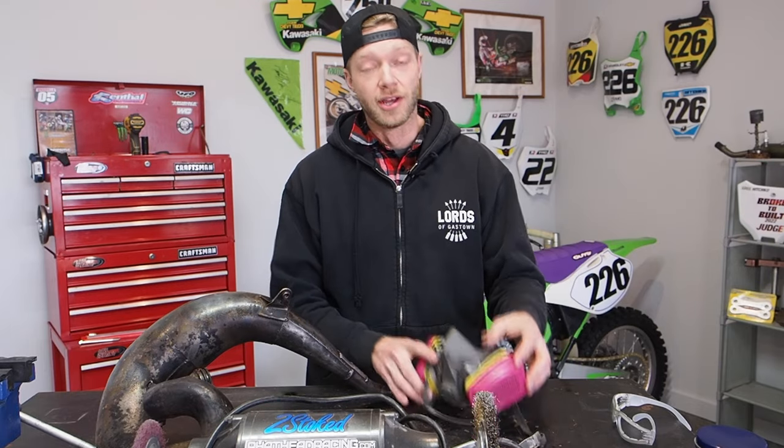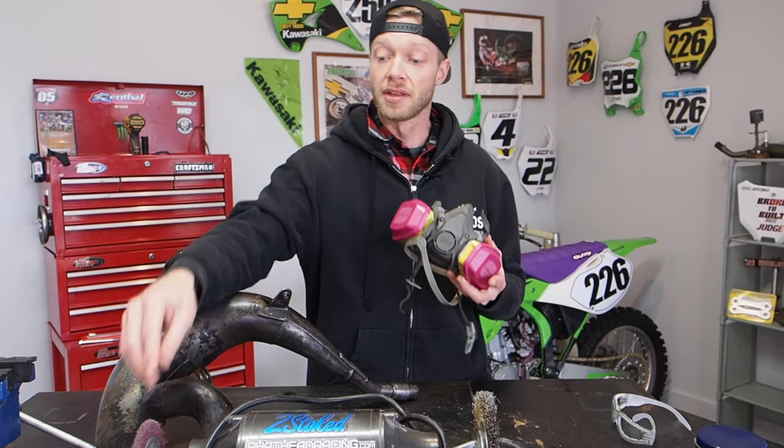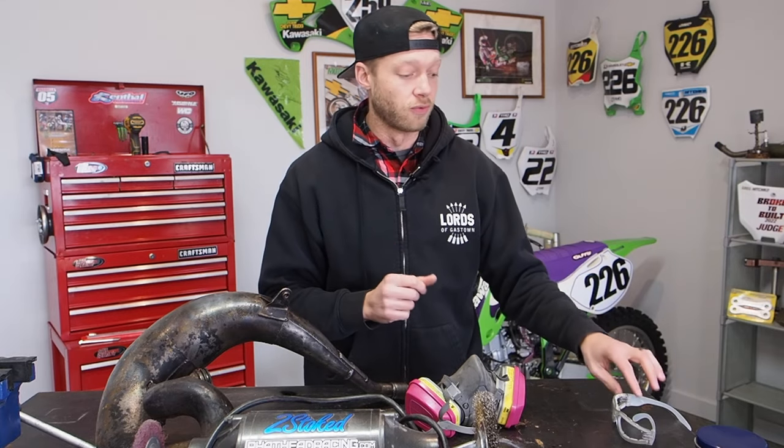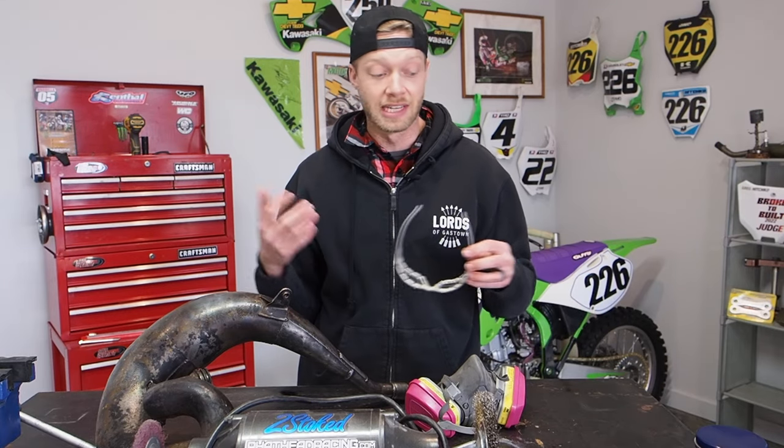And finally, guys, when you're using these prime wheels and wire wheels, do not mess with your health, your eye health, and your lung and overall health in general. Use a respirator so you're not breathing in the fine particles and dust that come off these wheels. Also, these wire wheels have a tendency to fly off, the little pieces of wire, so use safety glasses and keep your eyes safe.